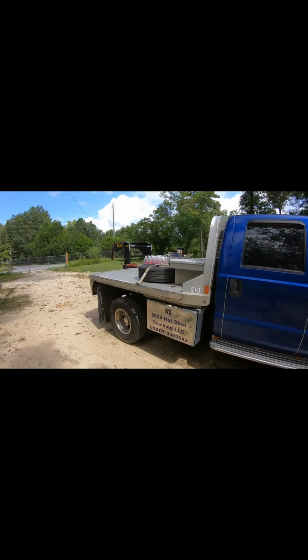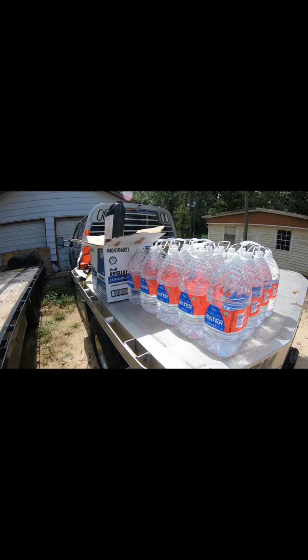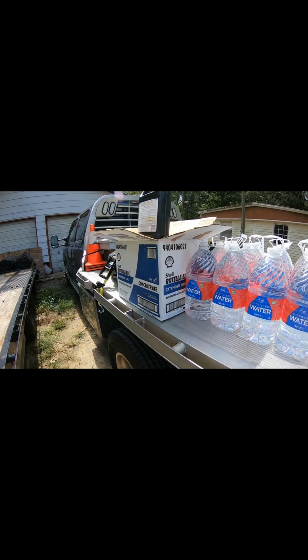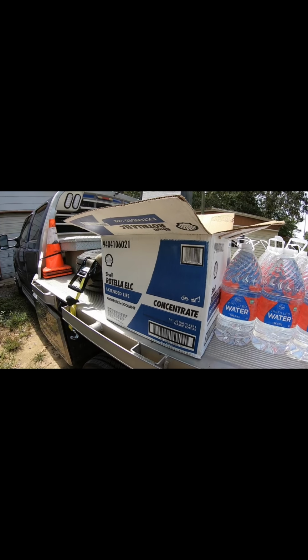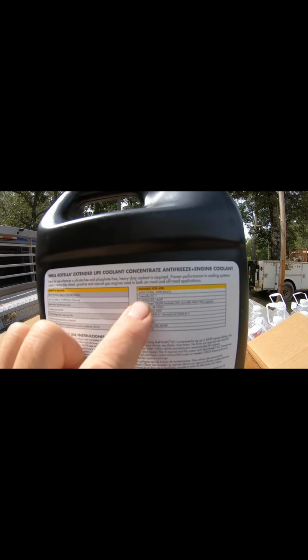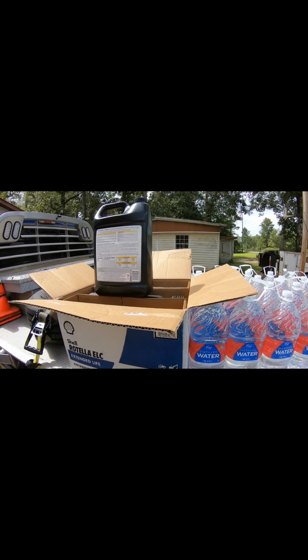So over here, this is what I've picked up to do the, I'm gonna redo my coolant. So this truck has had the injector cups replaced with the Loctite 620 sealant, so it is compatible with running the ELC. This ELC, the thing I'm looking for there, I don't know if you can read that, where it says Caterpillar EC1. That's the standard we're looking for on this thing. So I picked up, actually I got 5 gallons of the ELC. That's one extra.